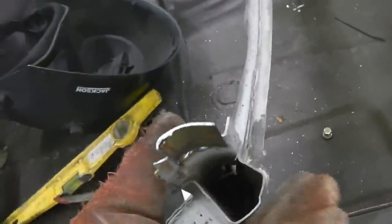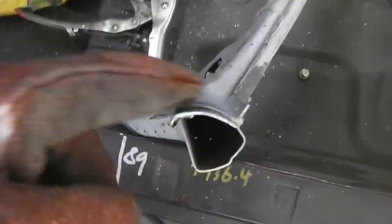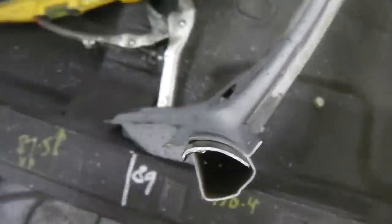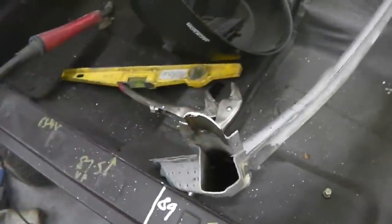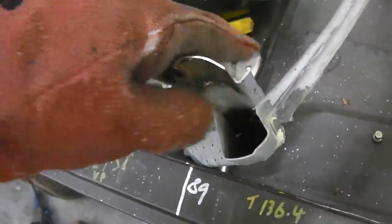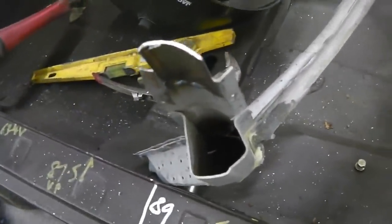Okay, I've added some inner fillets as well. Of course, best to get strength on both sides. I bet some of you are already onto that and say you should have done two fillets. I have. Second piece in there, so it's a double side. It just gives it more strength. That's a pro way to do it. So we're strengthening both sides now. Forgot about that, of course. And then they'll help fill the gap in on that A pillar that I've made because of my undercut.